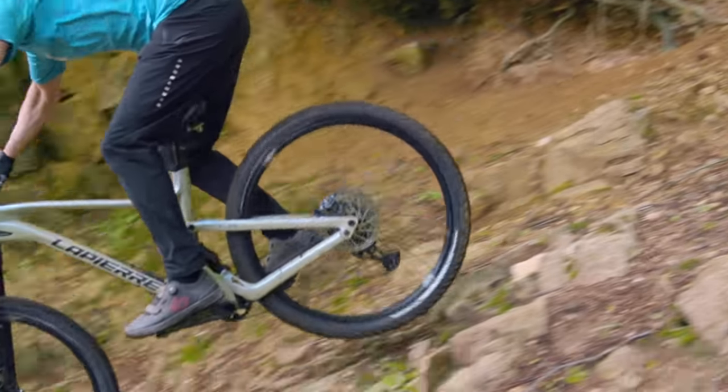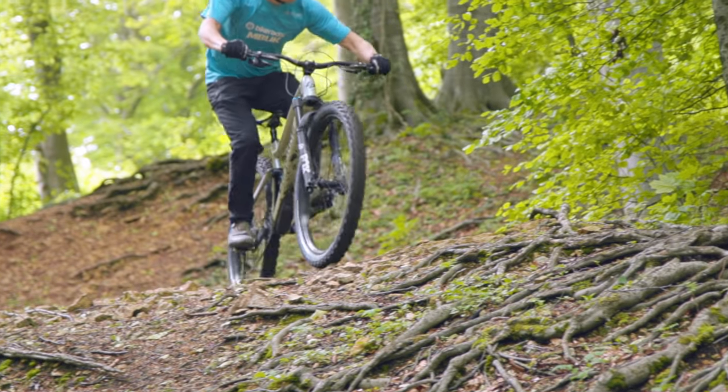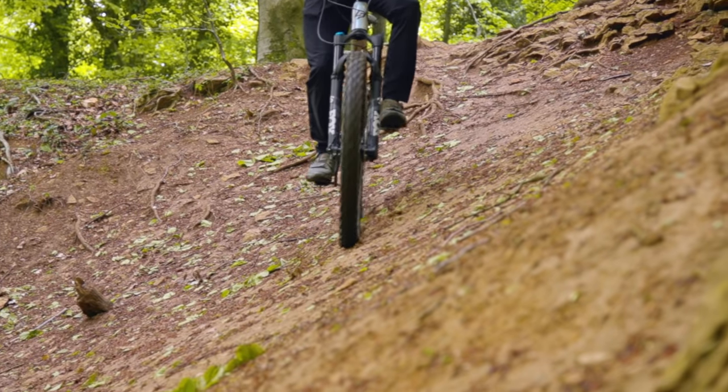So how do you know if you've got the pressure right? If I can feel the front tyre roll as I push it into a corner, or if I start feeling harsh knocks and dings through the rim when I hit a rock or root, I know I need more air in my tyres to give better stability and puncture protection. If my tyres are too high and my tyre feels like it pings off or slides off rocks or roots in an uncontrolled manner, or I'm struggling to hold a line when the trail is off camber, perhaps I need a little less pressure. It's a real balancing act, so get out there and start experimenting.